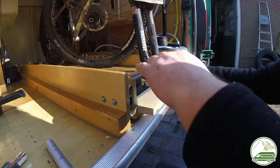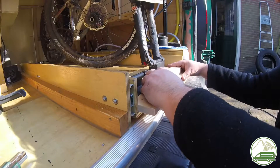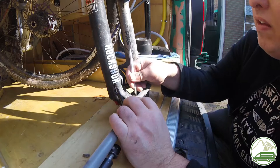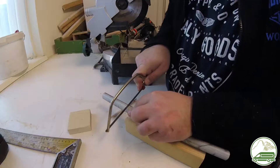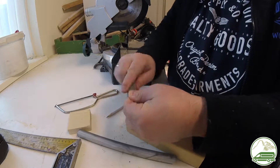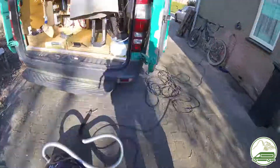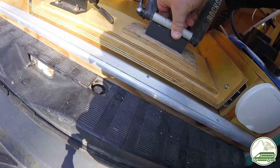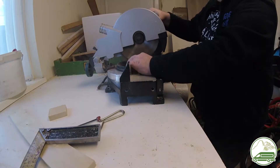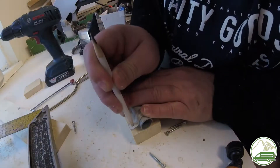To fit my new e-bike I needed another handmade bike hitch for a through axle. Another delta bike hitch with a quick release had to be removed. I made another DIY bike hitch using a leftover piece of wood and an electrical tube that fits the through axle exactly. I glued the tube in place before securing it with 3 clamps, then spray painted it in a dark grey color. This type of DIY bike hitch proved itself — I've been using the one I made earlier for about 2 years and it has never failed me.